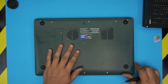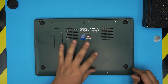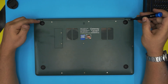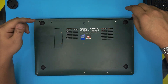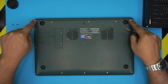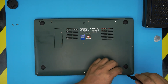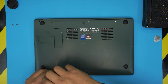First thing: power off the laptop completely, then flip it upside down so you can see the bottom. You're going to see a bunch of screws. There are two types — short ones and long ones. The two long ones are in the corners at the hinges, one on each side. Go ahead and remove those two long ones first and keep them in one pile so you don't mismatch them. Then remove all the remaining screws — including the one in the middle — and keep those in a second pile. These shorter ones are all the same size, so don't worry about mismatching them.